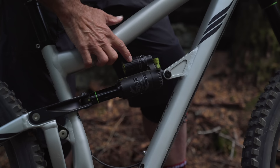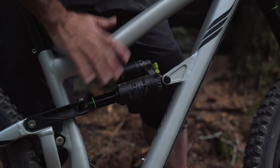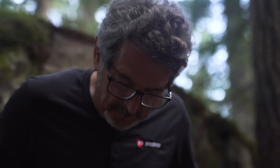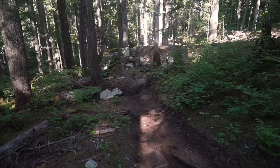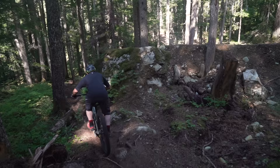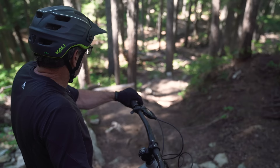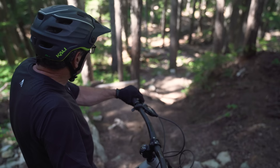One of the things we've always been fighting for at the $3,000 level is great suspension. We get the DVO Topaz Reservoir Shock with an extreme level of adjustability — you can adjust spring pressure, sensitive rebound, and low-speed compression. It performs well on the trail. Up front we match it with a DVO Diamond fork — 160mm of travel, adjustable negative spring, high-speed and low-speed compression, and 44mm of offset, which is great for trail riding with big wheels. It's a pro fork on an affordable bicycle.